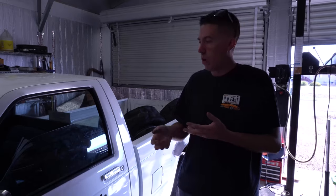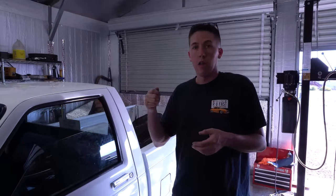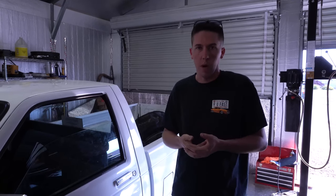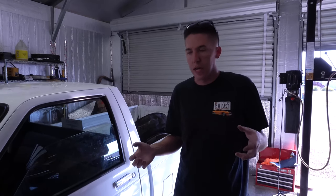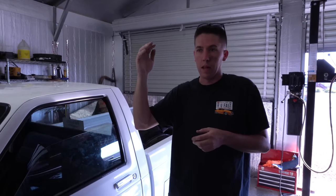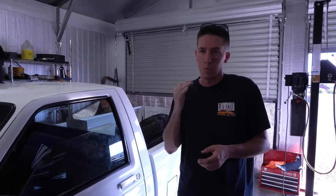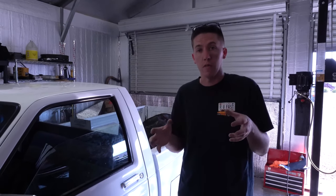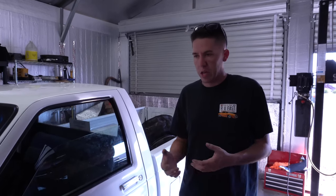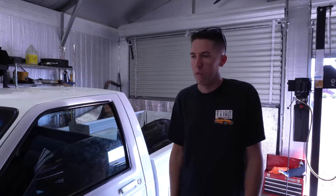The other things on Burnie, like I said, everything went fantastic. Everything's pretty much ready to go. Other than when I was shifting into second, it still wanted to bog down. I looked back at the tune, I could probably lean it out a little bit to try to help it, but I can be revving this at 7,000 RPM on the limiter, shift, and it'll drag it down to like 3,400 RPM and just bog it right there. It's like there's a super tight spot in the converter. I bought the converter secondhand. It was actually way too loose in a Turbo LS build, but I was just trying to figure out what I wanted to do there.